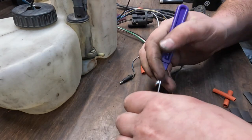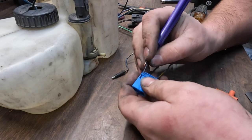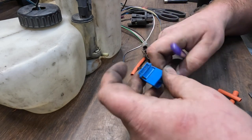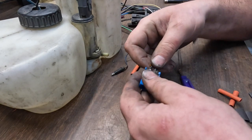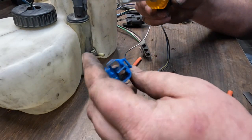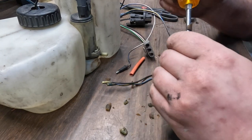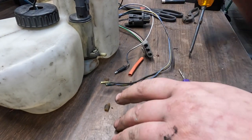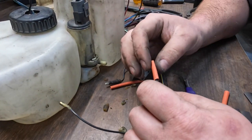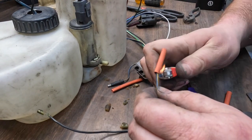While I was doing that montage, I found a few issues that need to be corrected. These little nylon inserts that hold the pins into the connector have two little tangs — you can pry that door open and you can see those inserts have turned crumbly. Clean that out a bit, mark which wire goes where of course. These are for the windshield washer pumps. It's a wagon, so we got two of them — sedans will just have one.